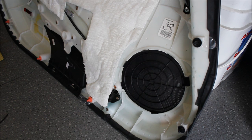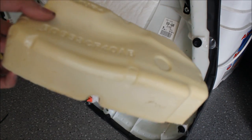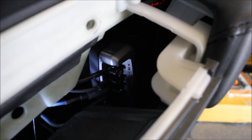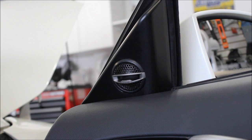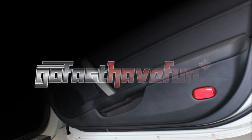With a big speaker setup like this, there are two modifications you'll have to make. You'll have to cut out this little support piece of plastic to clear the speaker — it's pretty easy to cut. The styrofoam in the inner door skin also has to be removed to get clearance for your crossover. For the tweeter installation, I decided to cut a hole in the factory location and bring the tweeter out — I wanted to see the Hertz logo, and I think the tweeter will perform better than being in the factory housing because the factory housing only has a few holes and this tweeter is much larger. You don't have to do it like this though — you can place it behind the factory housing if you choose because it is easier and it will still work. And there you have it — when you're all done, your door panels are going to look exactly the same but you're going to have a much better sounding system. Make sure to check out my Facebook and Instagram at AnthonyJ350, and our website at www.gofasthavefun.ca.